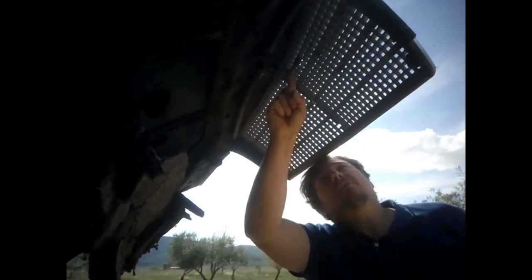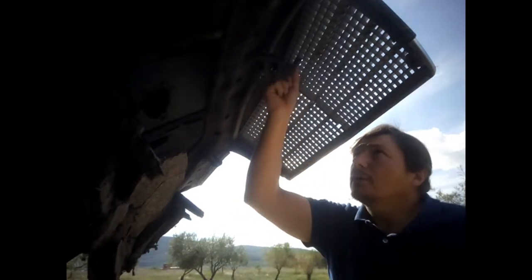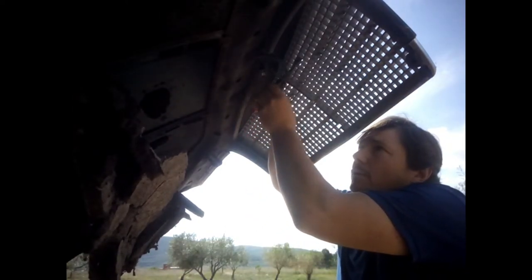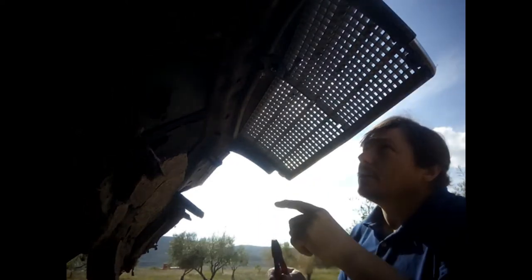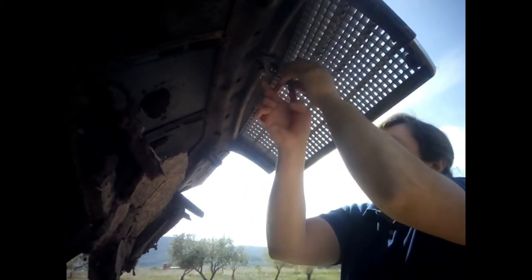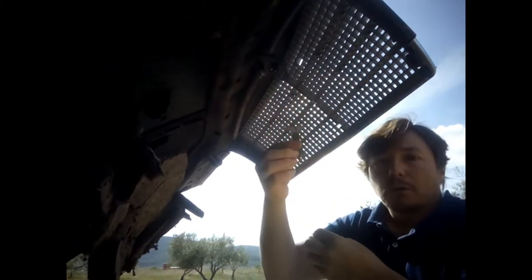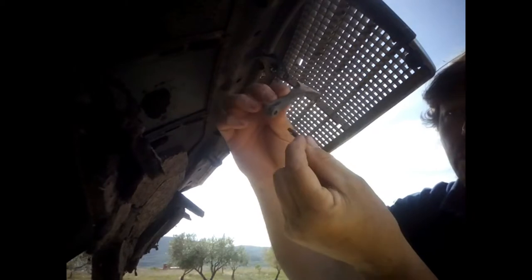The first thing we have to do is remove the lever that we use to open the bonnet. For this we're going to use the plier. If you look at the lever that goes through the grille, you'll see it's held by a pin. With the plier on the outside, we just pry it a little bit and push it — as you can see it's coming off. Now I take it out, and we remove the lever from the inside. This is what we removed, and this is the pin. In order not to lose it, we're going to put it back inside.